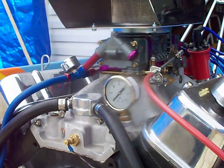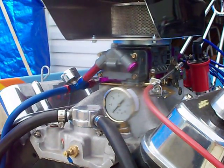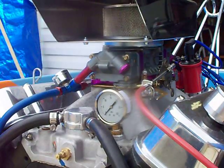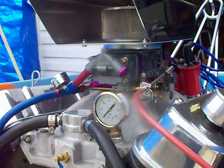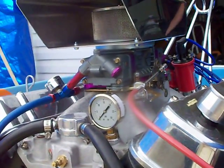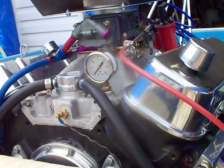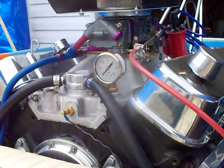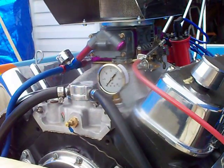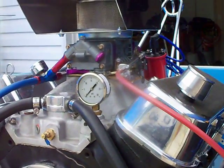I ended up with about five pounds of pressure at cruising. At idle it still drops down to about one pound, which is okay. Once I floored it I had about 10 pounds. You never want to exceed 15 pounds of pressure in a boat — that's really important. A lot of guys don't know about this and just throw their engines together. Also, changing the impeller and the pump can change the volume or pressure in your motor, so always check water pressure especially when you change the jet pump.